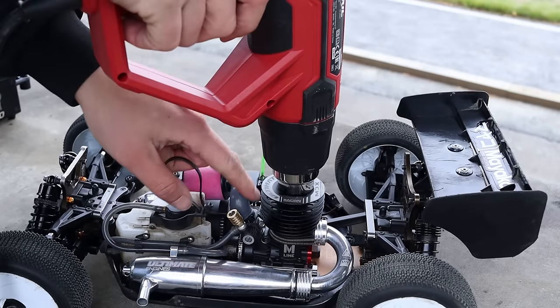I drive one fuel bottle this way, so 4 tanks of fuel. And again, I monitor the temperature. I make sure that the temperature stays stable. I wrap the cooling head because I want to run a very rich mixture at this point. Wrapping the cooling head means that I can run a richer setting without the engine being too cold. So I'm artificially keeping heat in the engine. Running a super rich setting so I have lubrication, but then covering the cooling head to make sure that engine temperature stays high.